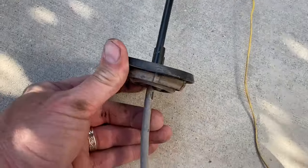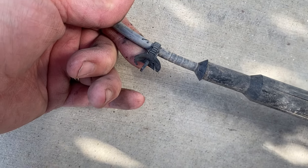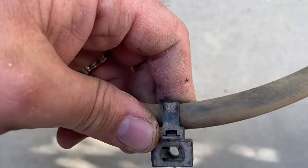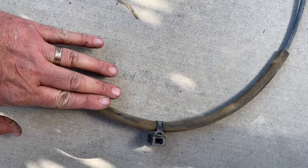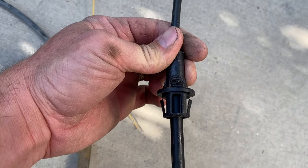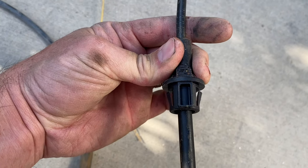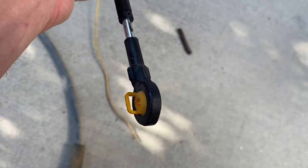This one you have to remove by prying it out, and that'll hopefully come on the new cable. This one goes over a bolt/nut — you just wiggle it off, you shouldn't have to pry it hard. I got one hand on this side of the frame rail where the cable was and another hand up over into the frame to pull it down. The only other tricky part is at the shift column: just like the transmission, it has a steel staple-like thing you pull out first, and then you push these tabs in to remove the bushing.